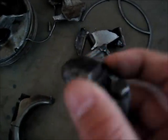Try and reassemble it here, that would have gone, I think that went there, if I remember. Try and find a part, yeah, it's pretty hard, there you go, that went there. This got more just eaten by the crank in the side of the block. That took a very hard hit. Just squashed it. Little fragment there that got taken out. Bits of the piston, bits of the bearing, which would have been in here.